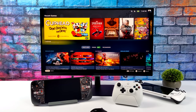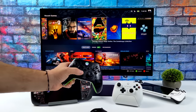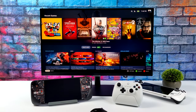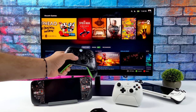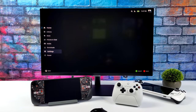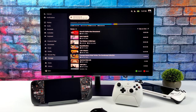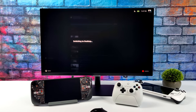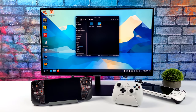We're going to get our video out over HDMI — looks really good here, and it will do 4K 60 or 2K 120. I've tested it with a little bit of video playback in desktop mode, and it does 4K 60 no problem at all. Obviously you're not going to be able to play a lot of games at 4K on the Steam Deck, but stuff like Half-Life 2 actually does run over 60 FPS at 4K on this device. I'm using an Xbox controller connected over Bluetooth. Heading into settings and going down to storage, the SSD is not showing up — and this really comes down to SteamOS. It's kind of Valve's fault, but JSAUX has made this simple enough to get up and running. We're going to head over to desktop mode; there is a script we need to run. We can download it directly from the product's docs page, but if we open up a file explorer, we can see that SSD in Linux right now.